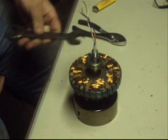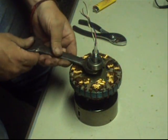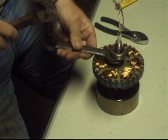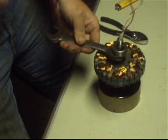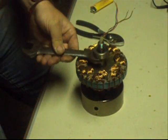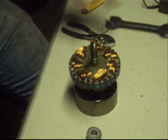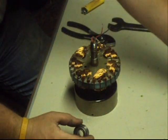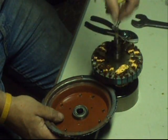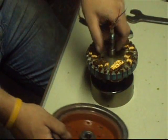If you can find a good heavy duty thick wrench, slip that up without getting on the coils and just lift it above the table just a little bit. Tap on this end — now it doesn't have to be too hard, it's mainly the vibration that does the work. Tap on your panels and this bearing will come off. And that's how you get that one off. Put it on this side, and now this plate can go on that side. I can leave these wires on this side — this is the side you want your blades to mount to and we don't have to go through messing with these wires.